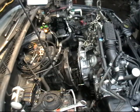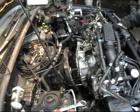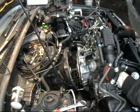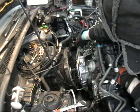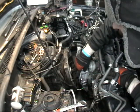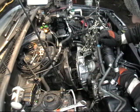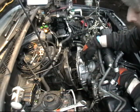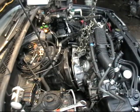With this engine, I mentioned off-camera that when you swap an engine or transmission, a motor that's not original to the transmission — you'll notice the dowel pins sometimes come out and stick with the engine or the transmission. In our case we had one dowel pin on the engine and the other pulled out with the last transmission. I drove this dowel pin in here so it'll match up. If you end up having two dowels trying to go together, you can take your 3/16 drift punch and knock the extra dowel out.